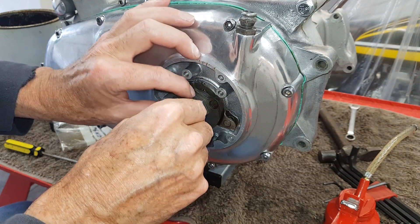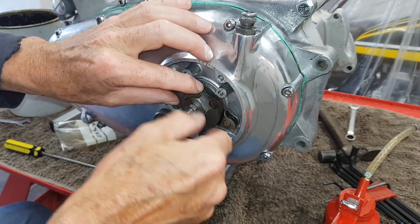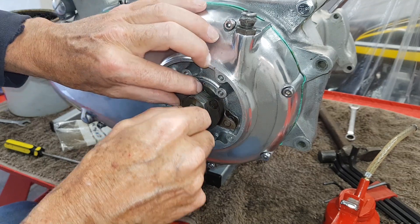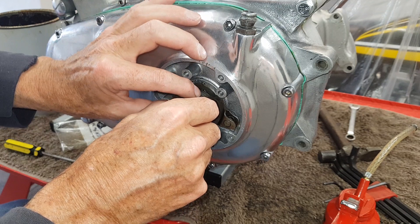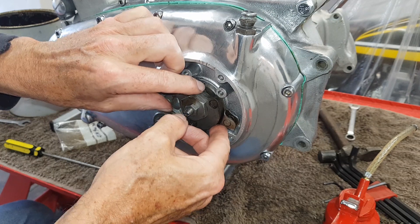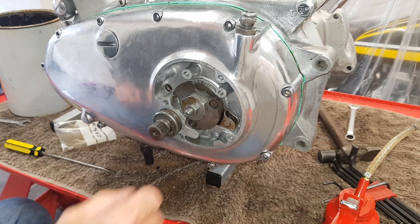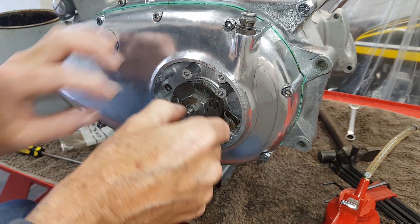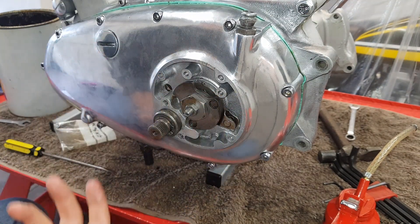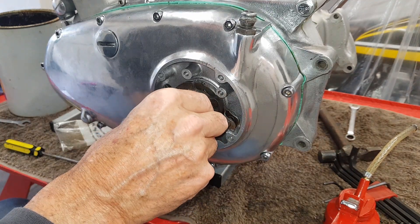What I use — don't tell anybody — is I just slack the nut off so it's slack. I know it's not pulling on that little thrust bearing that's behind here. I do that nut so it's just slack, and then you've got maximum efficiency from the clutch lever because there's no massive slack to take up. Slightly controversial maybe, but you don't want to over-tighten it and wreck that bearing, and you don't want it too slack or the clutch won't work.